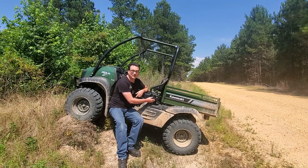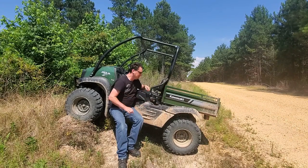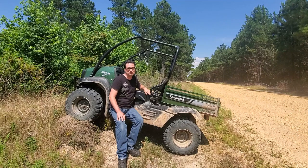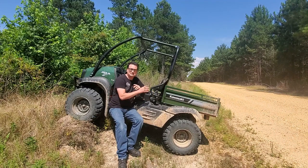This is very easy to take off — this whole box. There's just one bolt, then two tabs on the back of this plastic cover and it comes right off. You've got the full seat belt assembly exposed, and I have tried to put grease on that little piece that's loose.